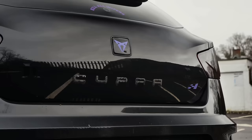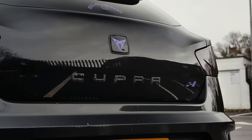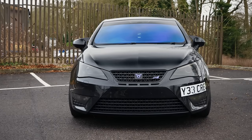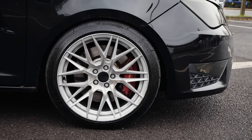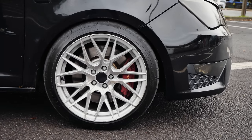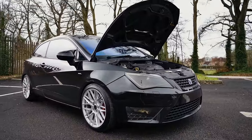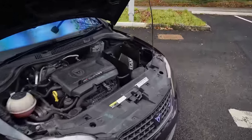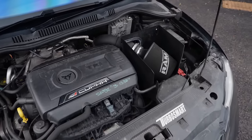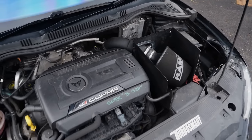What you would normally do for a Stage 3 really — it's a lot obviously, but it's not a crazy amount considering how much power you've gone from to what you're at now. Most of it is needed. Obviously the clutch is needed because everyone knows how rubbish the stock clutches are. You could run a stock intake if you wanted to, but personally you wouldn't. The main ones are the clutch and intercooler — and the turbo, of course.